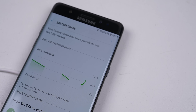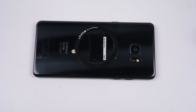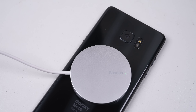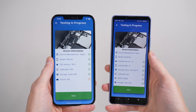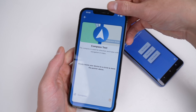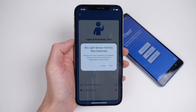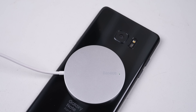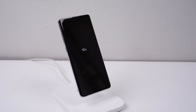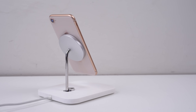If you're wanting to attempt this upgrade, check to see if your device reliably charges with a MagSafe charger before fitting the magnets. As a quick and easy option, you can just add the magnets to the exterior of the phone, despite it being visually unpleasant. If you're a phone repairer like myself, you may be interested in my application iTest, available for both iOS and Android. iTest provides the ability to test hardware functions of a phone or tablet with both a semi-automatic mode or manual mode, allowing you to easily test functions like the compass, gyroscope, proximity and light sensors, or even screen burn-in. At the end of testing you can get a nice overview of your results and easily share them. This has been a Hugh Jeffries video — if you liked what you saw, consider subscribing and check out the custom tech playlist for more videos like this one.